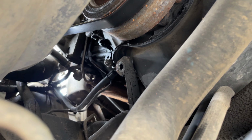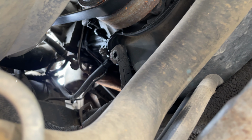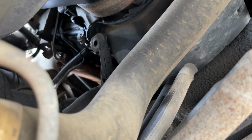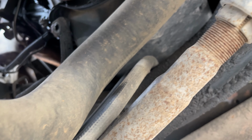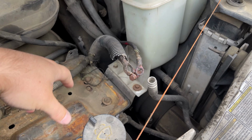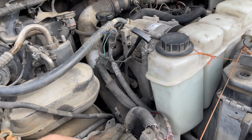come up underneath here, and right there you're gonna have a 15mm nut that holds this bracket on right there. You're gonna take it loose and then just running straight back down by the engine oil pan and going back to the starter, and we'll take it loose at the starter down there and then pull it this direction, and then pull it up and out of there. And then I'll show you our new harness and we'll start getting it slapped in there.